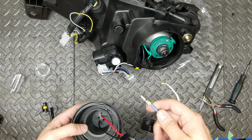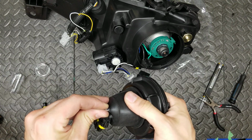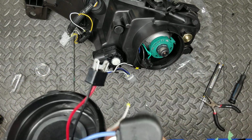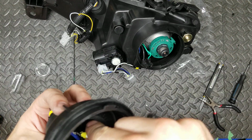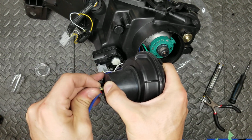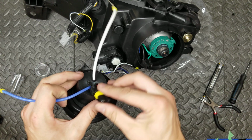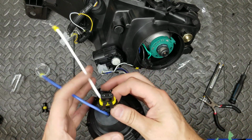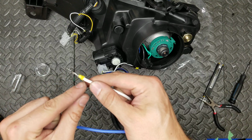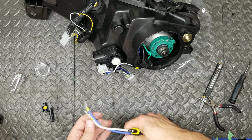That is that set. Now we're gonna push this, the inside to the outside. Go gently so that this yellow grommet thing that holds it in place, that's a technical term, doesn't get ripped off. Alright. Now they're a little screwy, but these 2 holes here are tighter from factory with more rubber around them. So that makes it tougher to take this through without damaging it. So while it looks a little strange, it's easier in the long run and it doesn't damage anything.